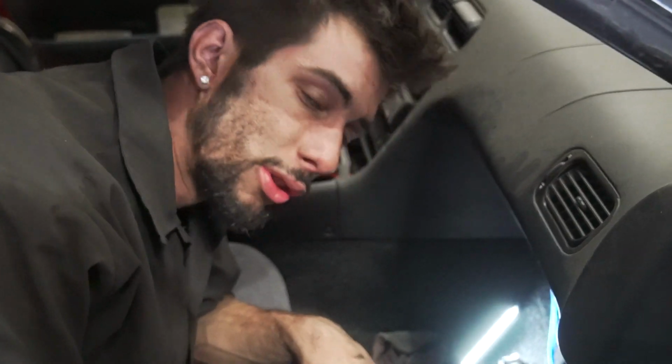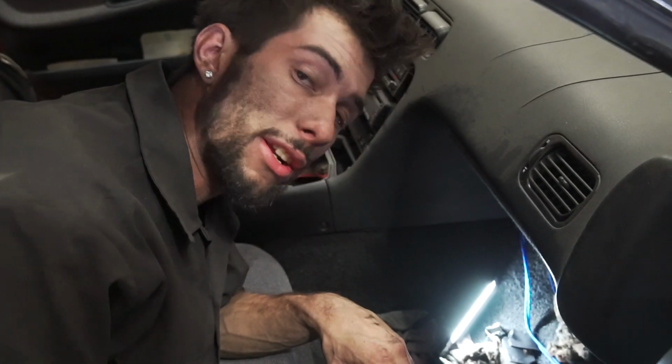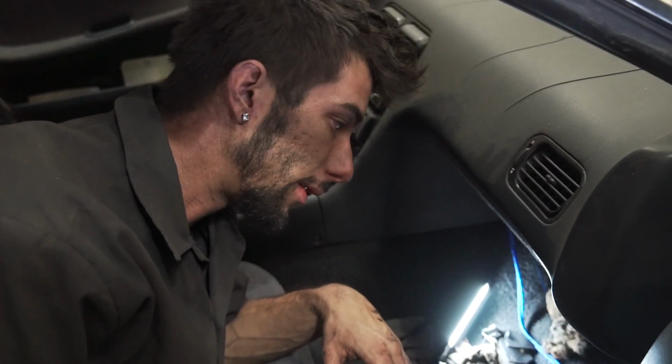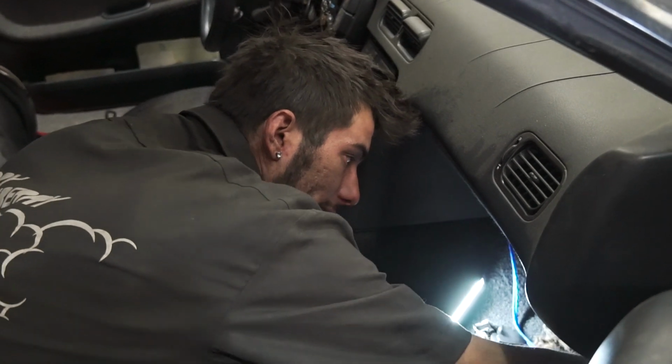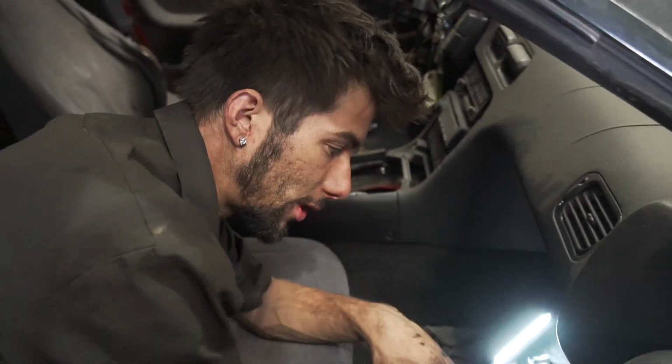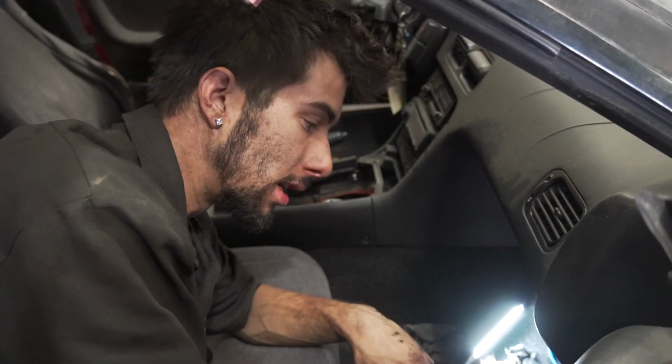And now we got double camera. Alrighty, so you guys already seen me pulling the wire out. You guys already see me pulling the wire through the firewall. Terry sent it over to me. I was out there clearing it. So now we've got all the cables that we need, meaning the engine harness. Since we're doing a battery relocation kit, we do need that 12 volt starter constant for the battery solenoid.